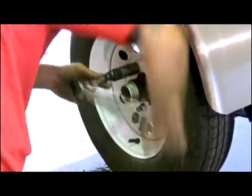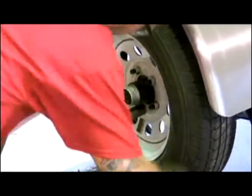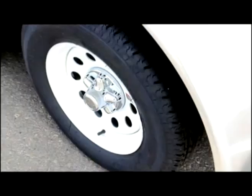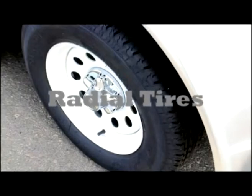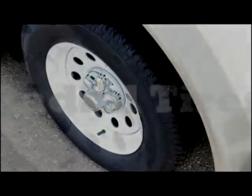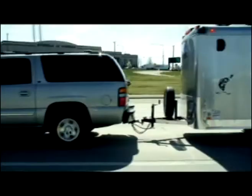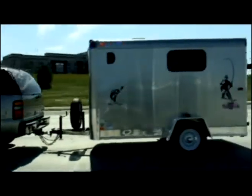All tires are standardized special trailer ST tires backed by a manufacturer's warranty and specifically designed to be used on a trailer, with rigid, sturdy sidewalls and other structural components to give stability and handle the stress and dynamics imposed by a trailer load. Radial tires come standard on all premium line Interstate and load runner pro series models. They run cooler than a bias ply — the cooler the tire stays, the less it will fatigue, which is better for long distance and higher speeds.